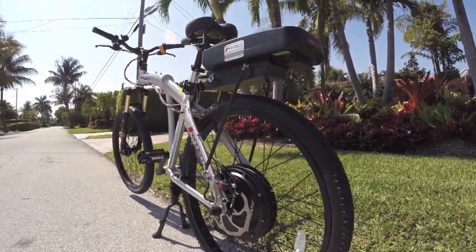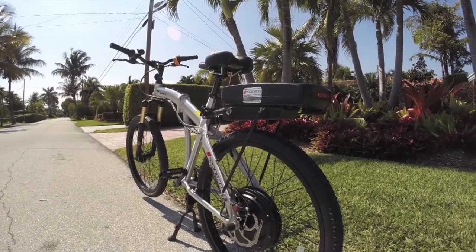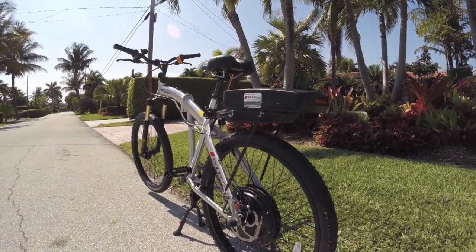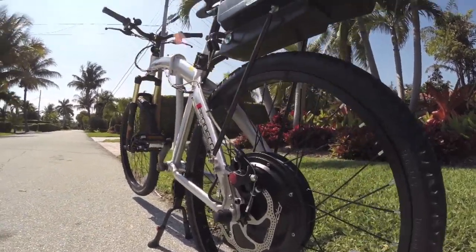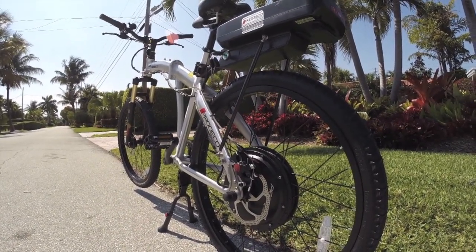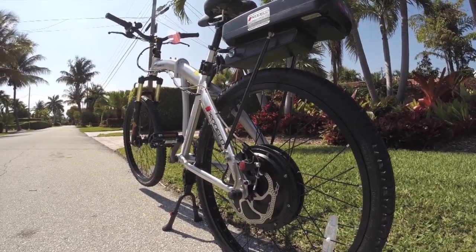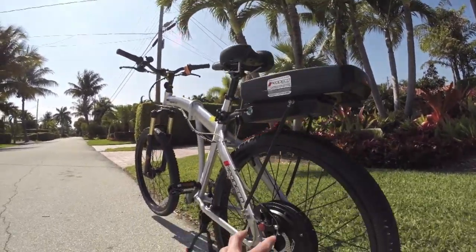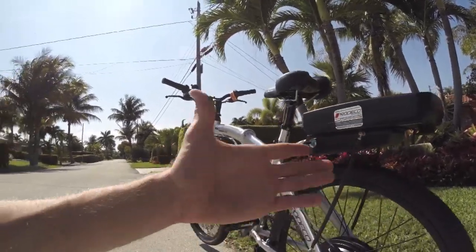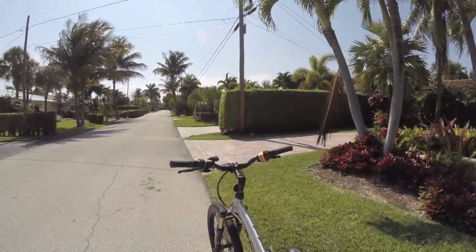That means it's gearless. A little bit more quiet than geared, but larger and heavier because it just uses magnets. Now, it is going to be pretty reliable, and it's a decent choice, but they don't really take advantage of some of the other opportunities with direct drive, like regenerative braking, that kind of thing. And again, with a heavier motor and a heavier battery pack back here, it'd be nice if they were spreading that weight out.